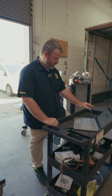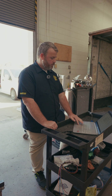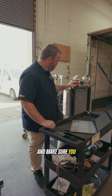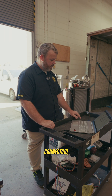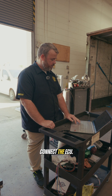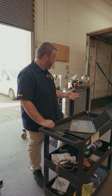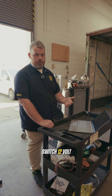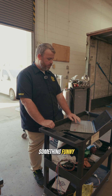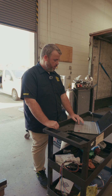This one works — I haven't broken it yet. But if it's not connecting at all, make sure your USB port is good to go, and make sure you have the key on. If it's still not connecting, I'll show what that looks like in the software right here. Let's try to connect the ECU — so we're plugged in, it's trying to communicate, but there's no power on the ECU side. If there's no power over here, it could be your Switch 12-volt having an issue. You could have a bad fuse somewhere, or something funny hooked up confusing the 12-volt signal wire.